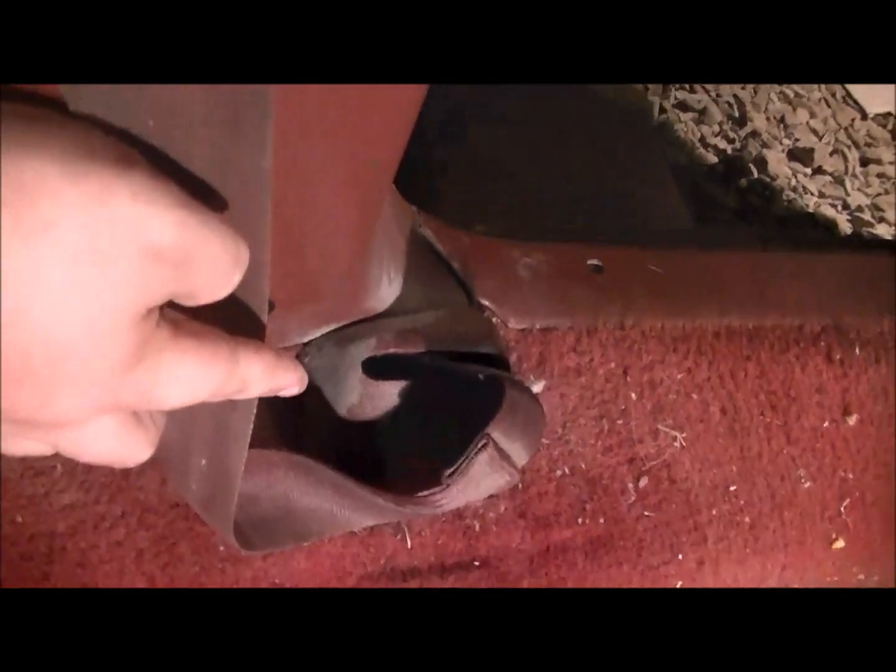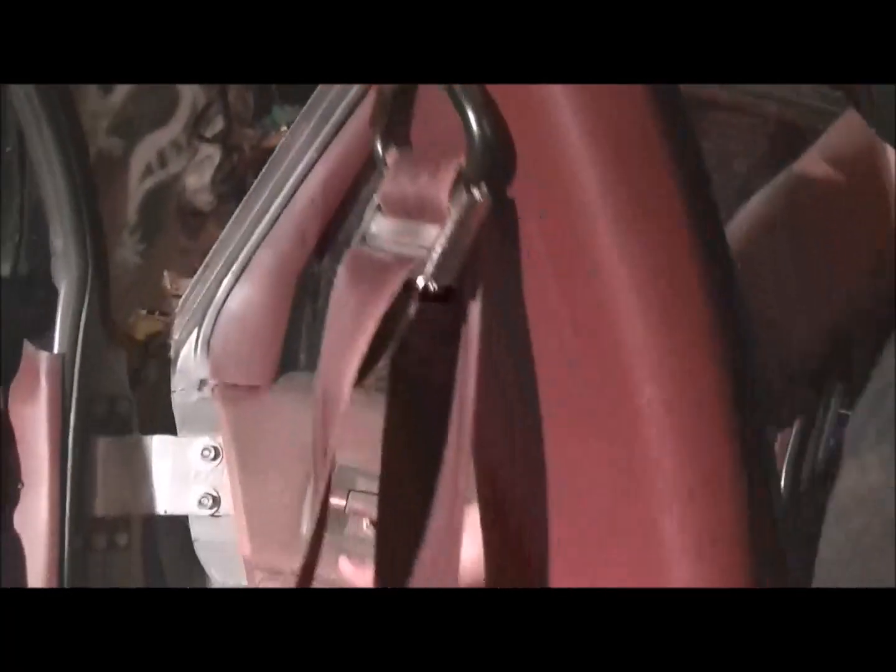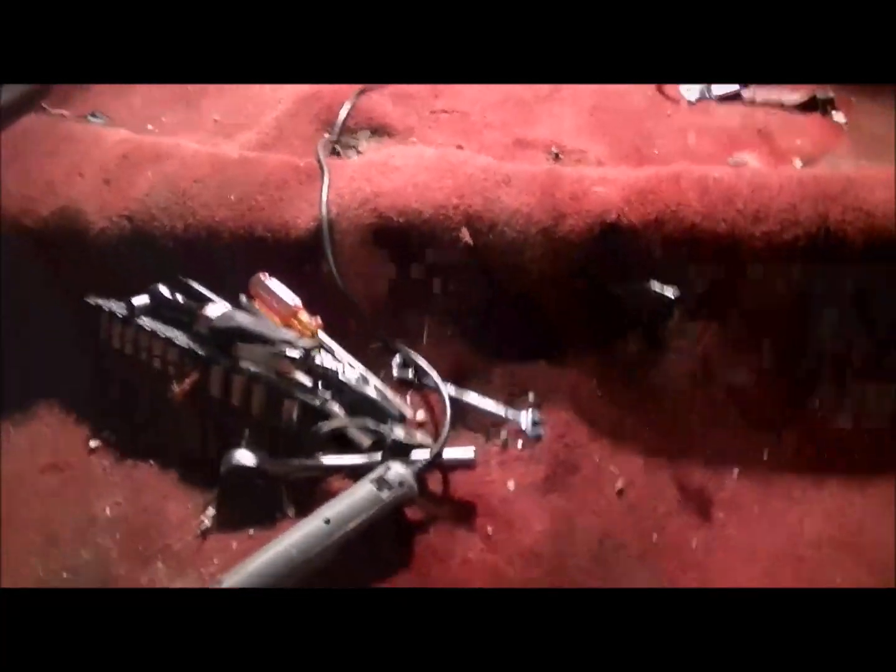All that, you'll have to pull the mount bracket in the floor for the seat belt. Then you have to pull this out to pull your seat belt through, and remove your top bracket, to remove all that to get the carpet out. Now, the only thing holding it is Phillips head screws. Now most of mine's already out. Try not to break it, because it looks like mine's been broken before.